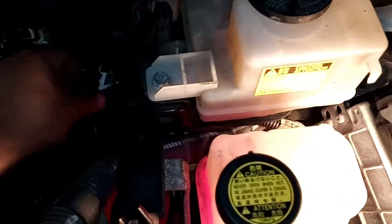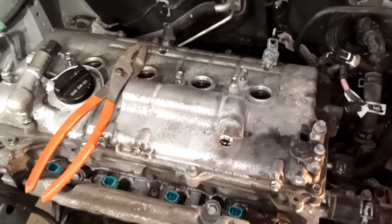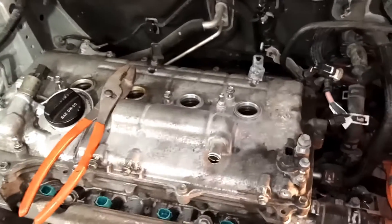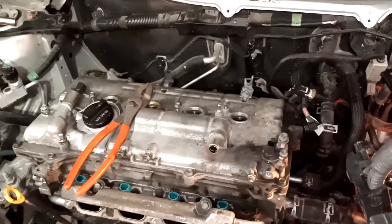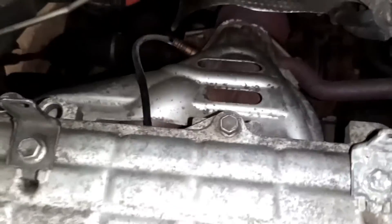More room to access things — kick this out of the way. Before we take the valve cover off, we should probably unbolt the exhaust header since that's behind there. If I put my hand there I'd rather have my hand on the valve cover instead of all the parts underneath, so this guy's next.